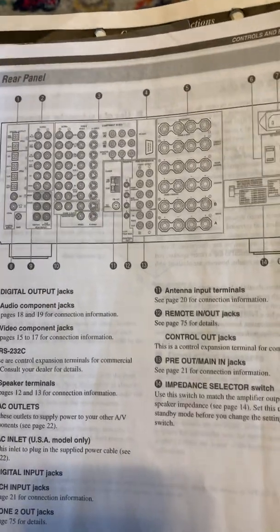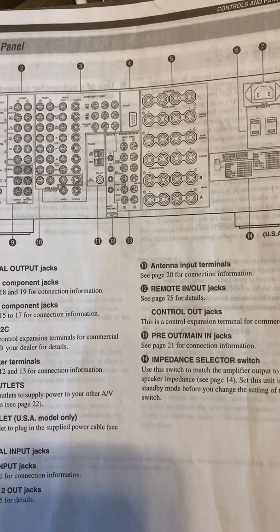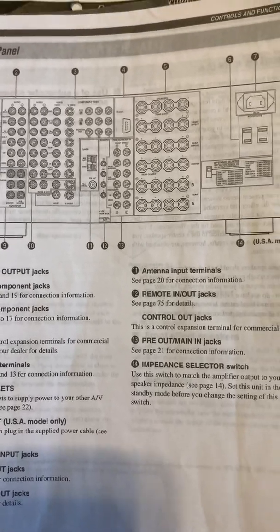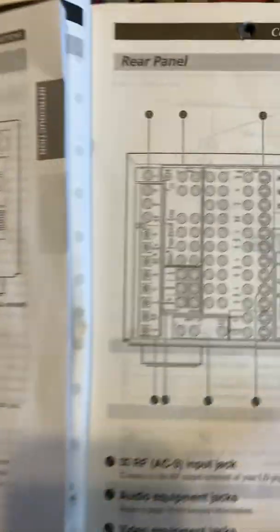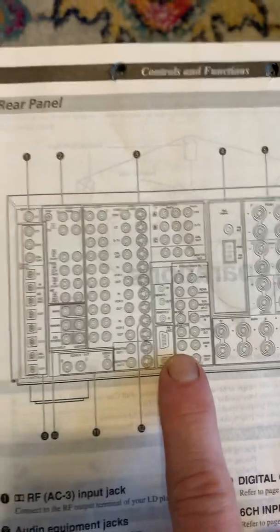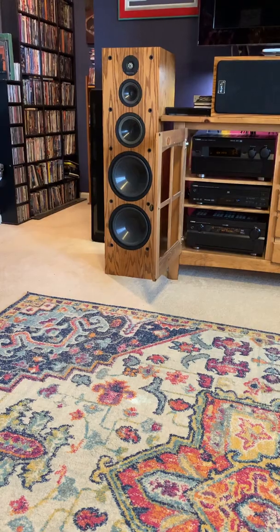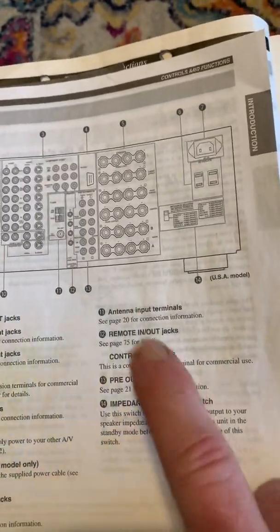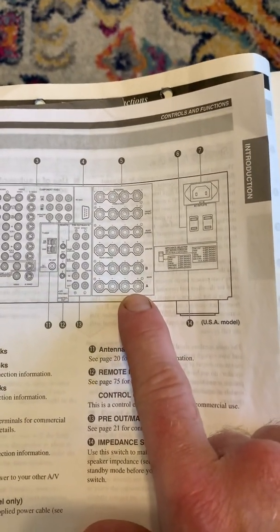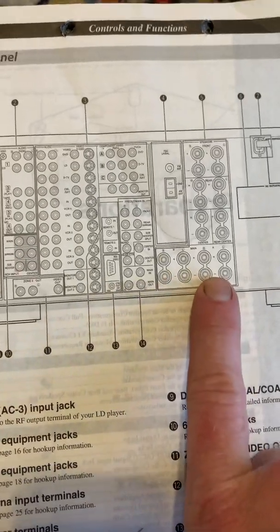So as far as the setup goes, these are the two manuals — this is the back of the RxV3300. In order to hook these up as dual receivers, I'm using the main outs and in one case the six channel input. For the main speakers I use the main outs from the RxV3300 going to the main ins of the RxV1. That gives me basically the RxV1 driving the top half of the CS3009 speaker — it's a three-way speaker with those top three components. The bottom two woofers are still driven by the RxV3300, so speaker A is wired to the bottom posts on the CS3009 and the top posts are wired to speaker A on the RxV1.